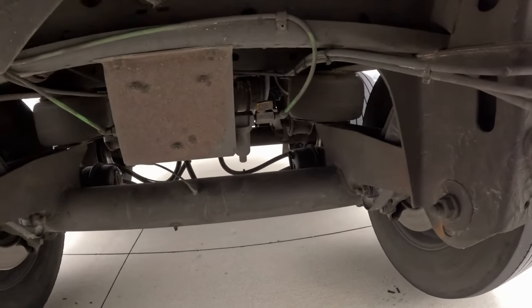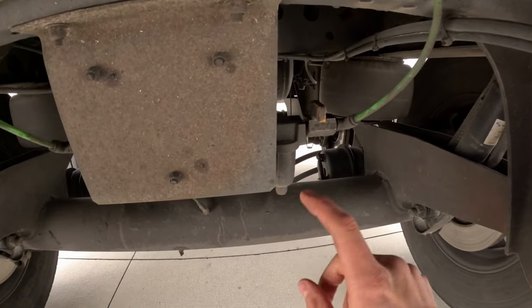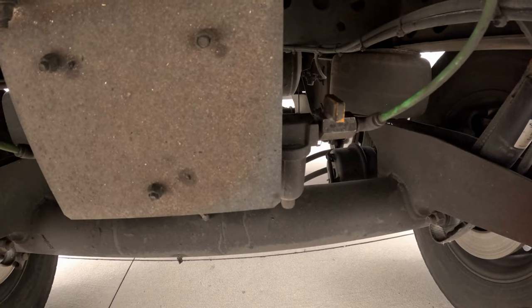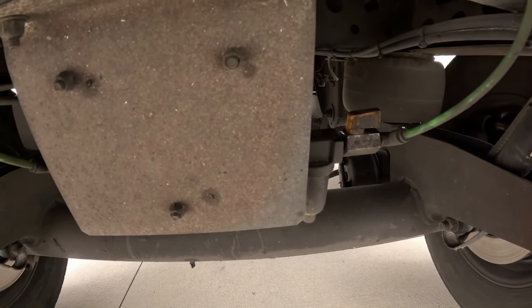If your tire is not pumping up, make sure that the tire inflating valve is open. In this way it's shut — we can hear it stopped pumping up the tire. If we open it again, it continues pumping it up.